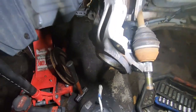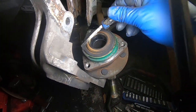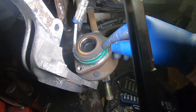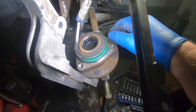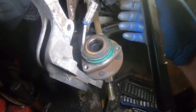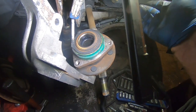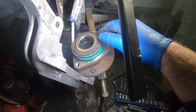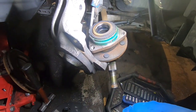The customer went ahead and okay'd a new bearing. I don't see anything wrong with the wiring, which doesn't totally surprise me because it wasn't acting up all the time. I drove it for about 15-20 minutes before the light came on — it's actually raining today. It wasn't a constant fault code, just coming and going. I'm going to go ahead and replace it. The wiring is obviously working because it does work most of the time. You could have the wiring harness issue — that's common on these, and the harness is about $40 at most places — but I don't suspect that because it's working most of the time. We're going to replace the bearing.